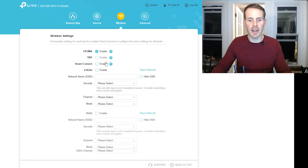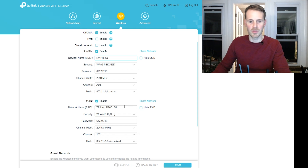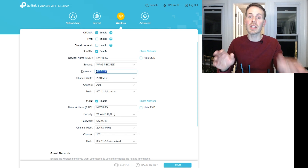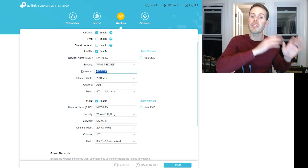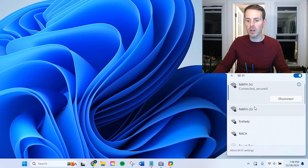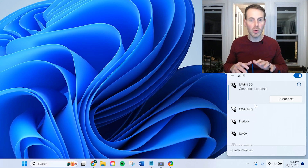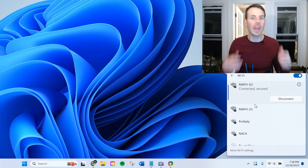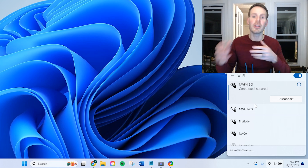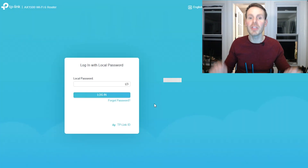So I'll go to the wireless settings. For the 2G, let's do Network From Home 2G. For the 5G, let's do Network From Home 5G. And then I'll change these passwords to the same passwords that the old router was using for its wireless networks. I made those changes and hit save in my router settings. Now in the available Wi-Fi networks, we only have the 5G and 2G Network From Home wireless networks. So now effectively, our devices will automatically connect to either the wireless access point or the new router, whichever is providing a stronger Wi-Fi signal — and it will do this automatically. You don't have to manually jump to different Wi-Fi networks depending upon where you are in your home.